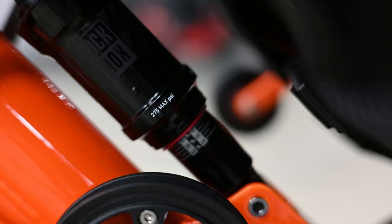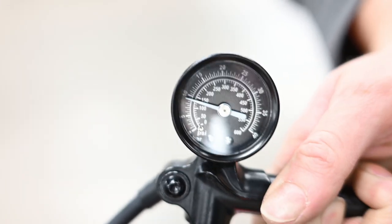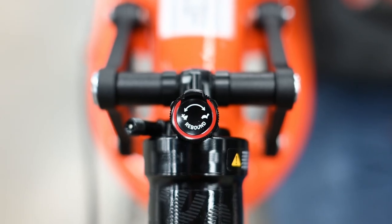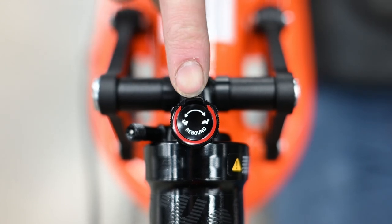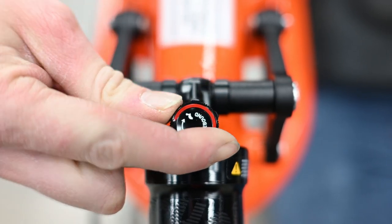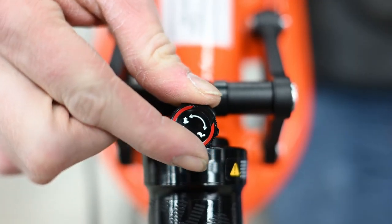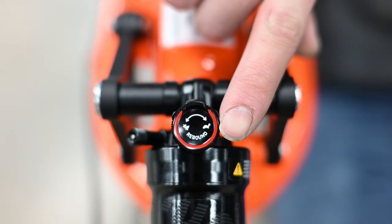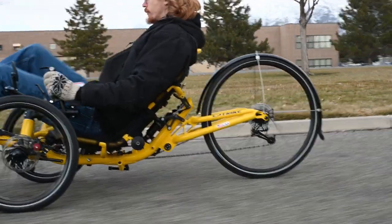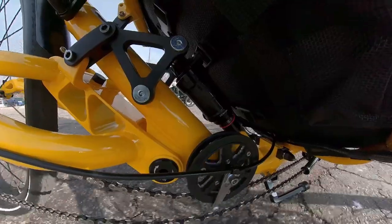Reset the rubber band and sit back down between each inflation or deflation. Once you've reached the 25 percent mark, note the PSI for reference and replace the valve cap. The rebound dial changes the speed at which the shock decompresses. There is a pictogram of a rabbit and a turtle with directional arrows on the dial face. The dial has 11 positions — start at position 5, test on bumps, and adjust toward the turtle if too springy or toward the rabbit if not responding fast enough.